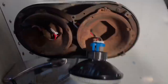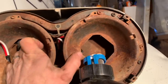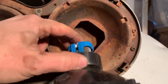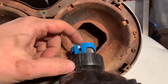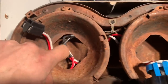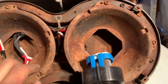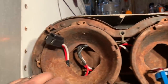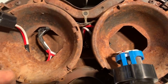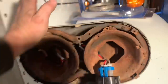The headlight buckets are not designed for these newer bulbs that go deeper with this connector, so I had to hole-saw out a gap on both sides to let this fit through. I should probably give a little bit of paint to this rusty metal here and clean this up. What I thought was going to be a 10-minute job is now a good hour - great.